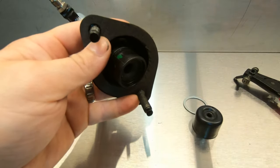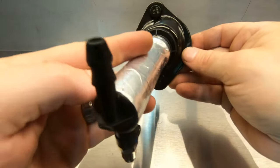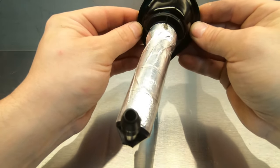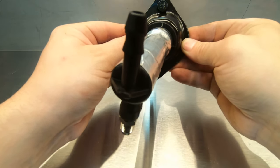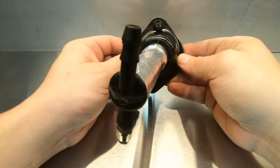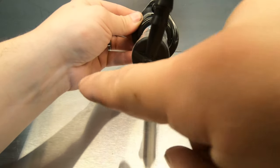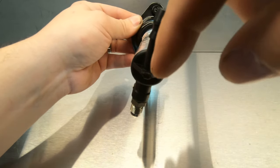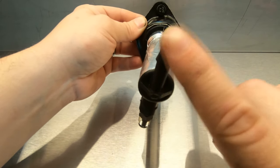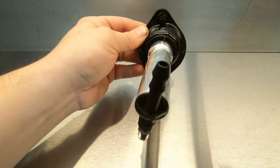Put the snap ring back on. And there it is — back together. Now you can see, so if it's up against the firewall, we're indexed much closer to vertical. Whereas it used to come out like that and hit the header. Now our pressure line's going straight down — it's much closer to straight down — and our remote reservoir line is much closer to straight up. So let's go test fit it.